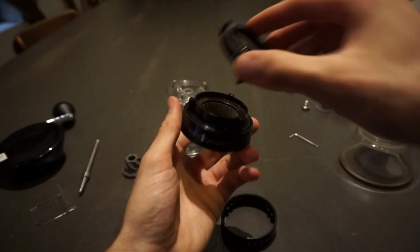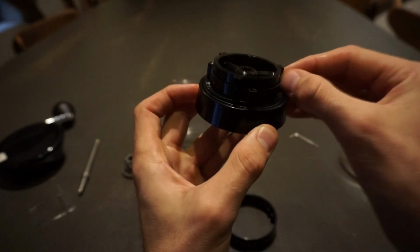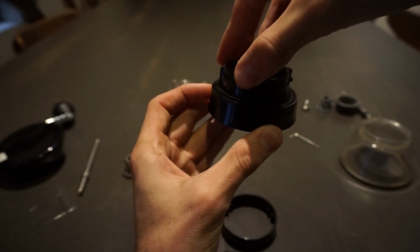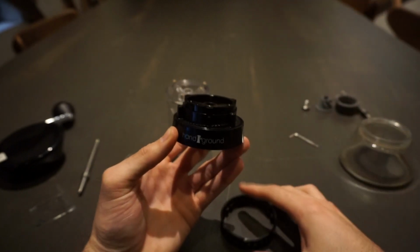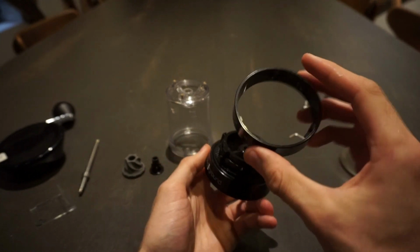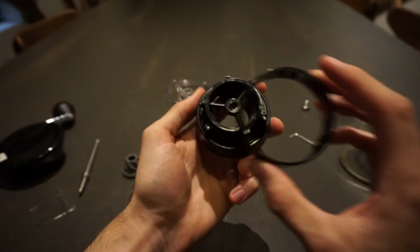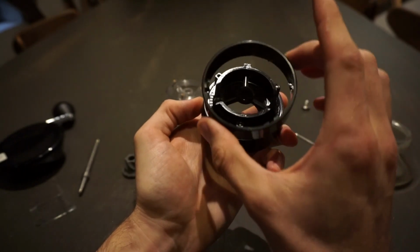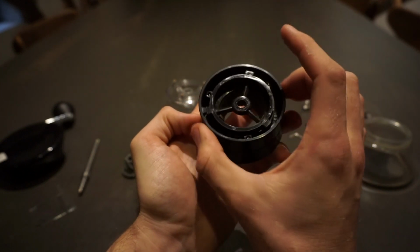And then the stepper piece sits right on top of the steps piece, so that the legs are on the outside, and you can see as you turn it, you get that clicking motion or feeling that you get when you change the course setting on Handground. Now we're going to take the course adjustment ring and place it over the steps piece, ensuring that the inlets here go over the pegs on the legs of the stepper piece. This is so that when you turn the ring, you're also turning the steps piece.